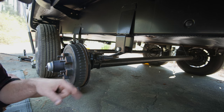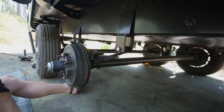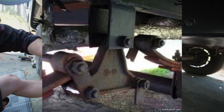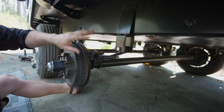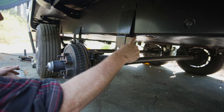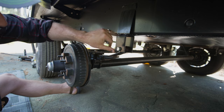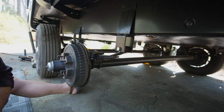I've got the tire off. One big thing I wanted to point out: these are your front spring mounts. You'll see in a lot of Facebook groups that this bracket can get twisted off or shear off. This frame actually has an extender plate to bring the shackle mount out a little bit — I haven't seen failures with this specific style, but it's a newer frame. What we're going to do is take a piece of quarter-inch plate and weld it onto the back side so it's solid, get everything repainted afterwards, and I'll also touch up this plate with a little more fill weld just to add strength.